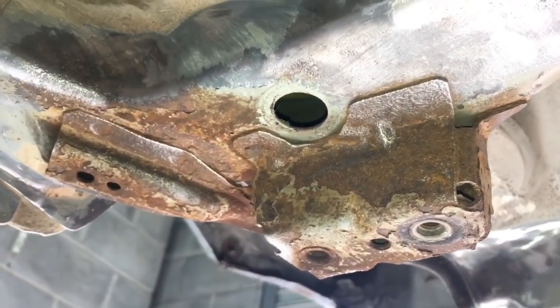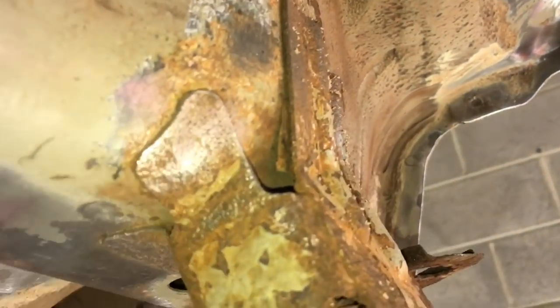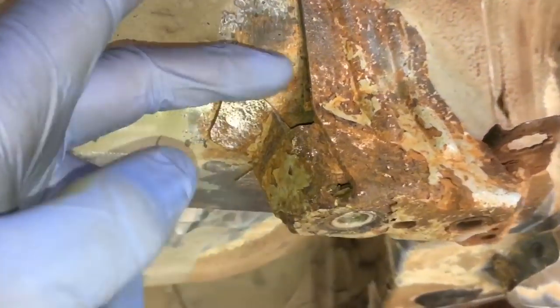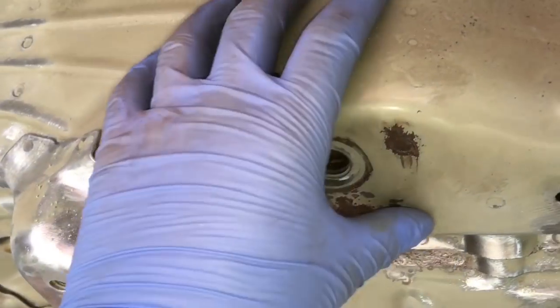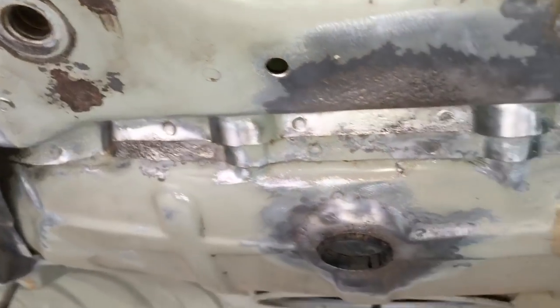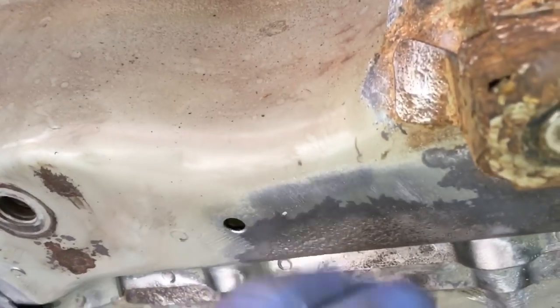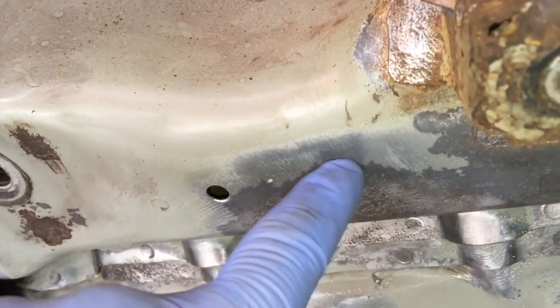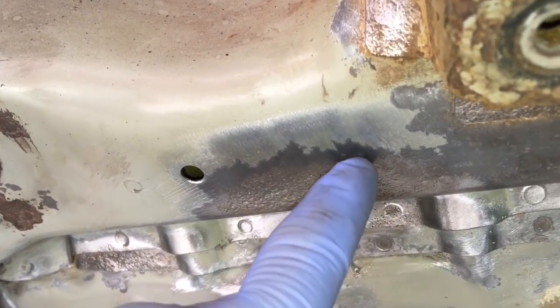The only way would be new metal, which obviously isn't viable for most cars, so you just have to knock all the corrosion off to bare metal and then treat it with something like Por-15 Metal Prep. We're doing the backs of these brackets as well — they're terribly affected. We'll actually be trying to take these brackets off to get the corrosion out from not only behind the bracket but also on the rear axle carrier panel behind it, as there's just no way to get any tooling inside otherwise. There's also corrosion where the fuel tank was rubbing along that edge of the rear axle carrier panel. Up at the spring turret where the spring perch sits, you can see the creeping lines — we have to make sure that we get the e-coat well away from the creep line.